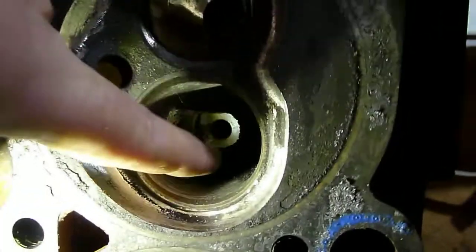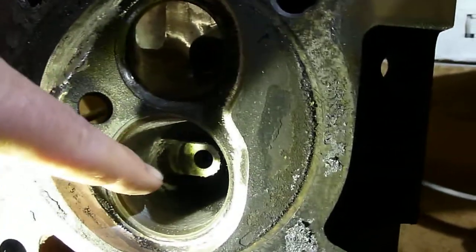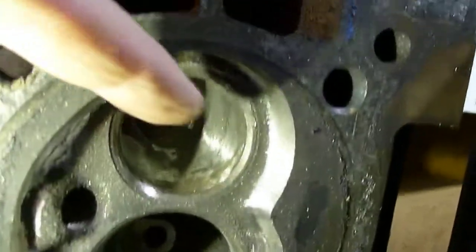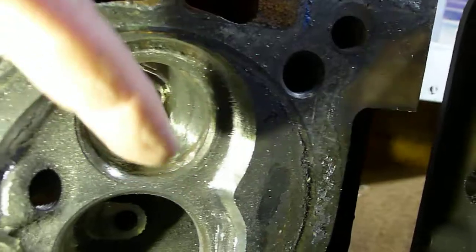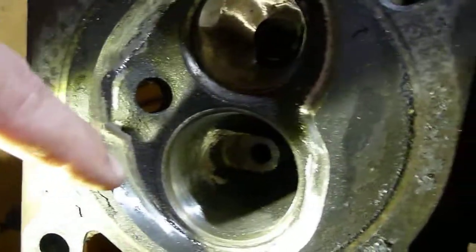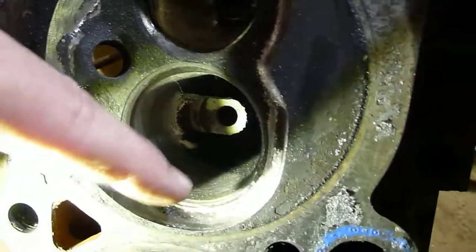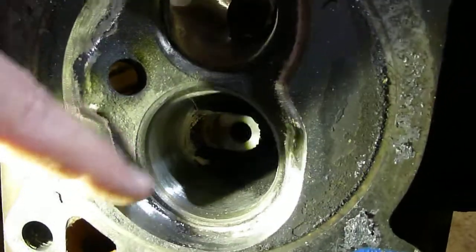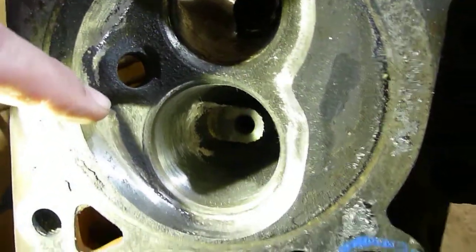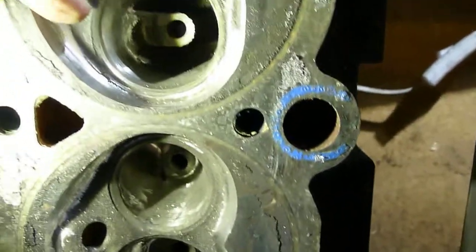You don't need to teardrop that — that's only to look pretty, and for quarter mile you want to get maximum effort out of these heads. Another look at the kidney chamber — it's swept right back. You can do this by hand if you've never done anything before: get very rough sandpaper, go over this by hand, just smooth it up the best you can. You get rid of all the sharp edges and it reduces the detonation risk if you've got decent compression in the motor.